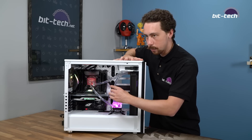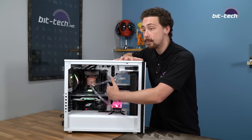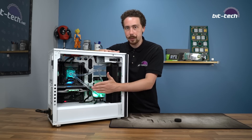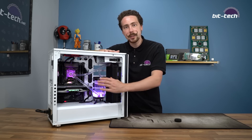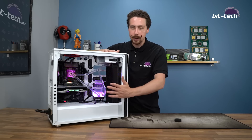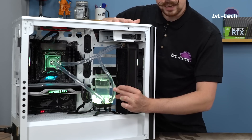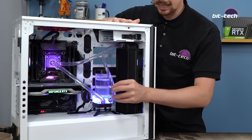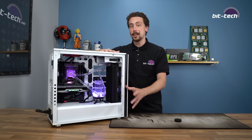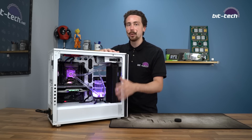So if you wanted to mount this up on the back somewhere where the hard drive cages used to be, you're out of luck. These go right up against the front panel and if this was only one centimetre further forwards they'd be scraping against it, with a good risk that it would kink. Like if I move this a bit further you can see it starts to flatten already, so just having it like that is already a little bit too close. Personally if you are getting a kit like this I would always make sure to get a couple more angled adapters because they can make all the difference.